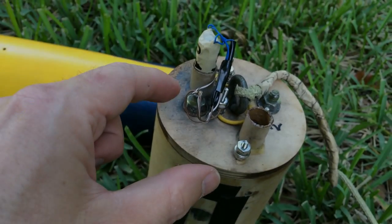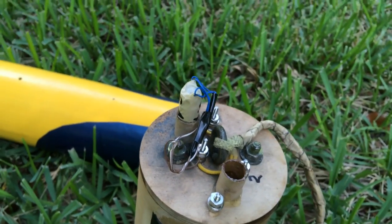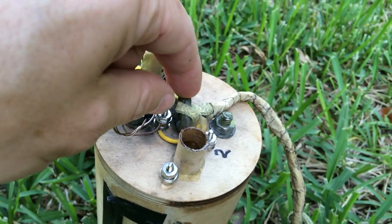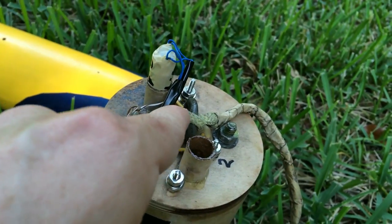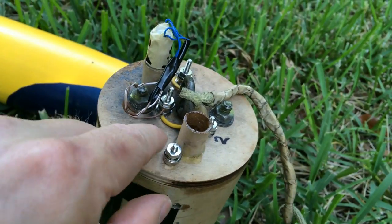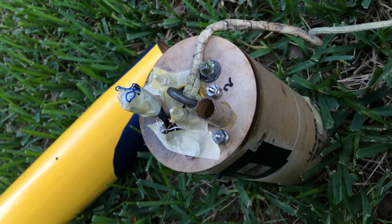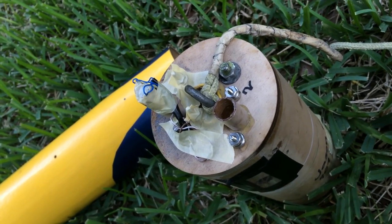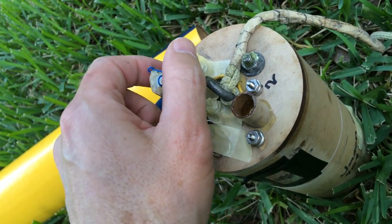I'm going to tape over these actual terminals here with some masking tape, so that there's no chance that that's grounded when I put everything together, especially if there was a quick link or anything like that on this section, you could, in theory, get a ground out. Also, it keeps the contacts extra safe, so that there's no chance of disconnection or that sort of thing. You can see that I have generously applied all kinds of tape to make sure that all the connections are insulated, as well as secured some of the electrical wires so they're a little bit better bundled up.